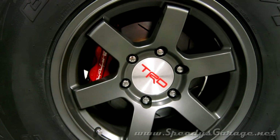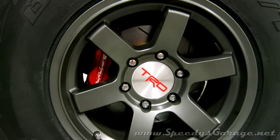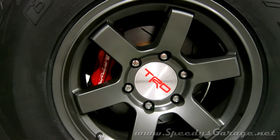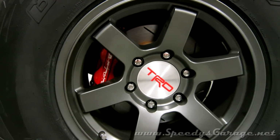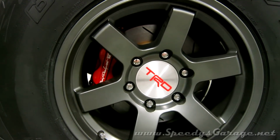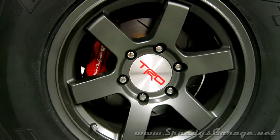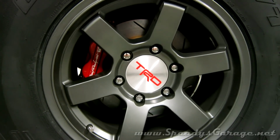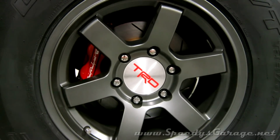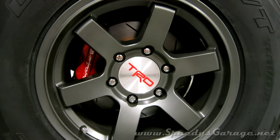This isn't required, but it's something I typically do just to get everything set and ensure long pad life and rotor life. Basically how you do it is you drive up to 60 miles an hour and you gently apply the brakes and bring the vehicle down to 45 or 50 miles an hour, and you do that 5 or 6 times in a row to heat the rotor up to operating temperature. And then you want to go up to 60 and then really apply the brakes hard, almost engaging ABS, and bring it down to 10 miles an hour and do that 5 or 6 times.